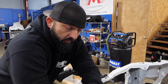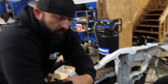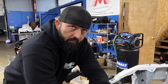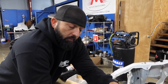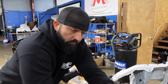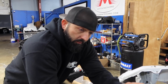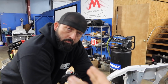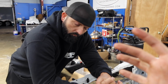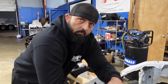Just whatever I think I need on it. So if you need to cut a 90 in half to get a 45, that's fine. But it's a short 45. It's not like a regular 45, which is more or less a long radius in this kind of situation. So I like to try to have both. I don't want to have to cut them unless I actually have to, just to sweep it in real quick. So you're not cutting the bends in the middle, you're just cutting the ends off to have the right length of bend. Yeah. So 45s and 90s are going to be the bread and butter for this.